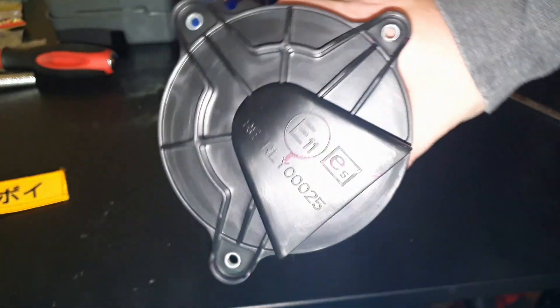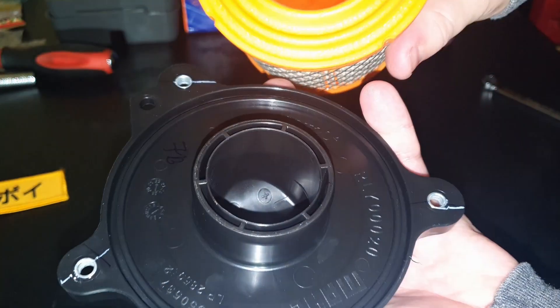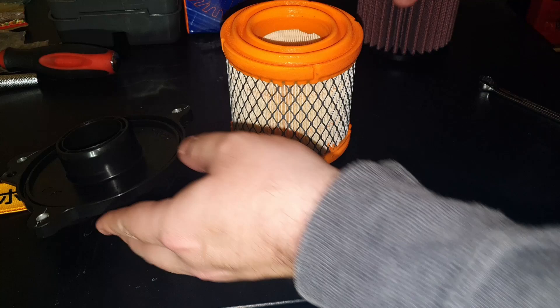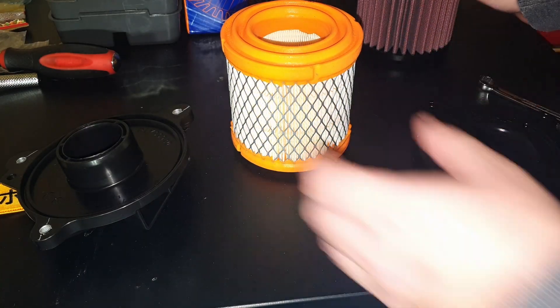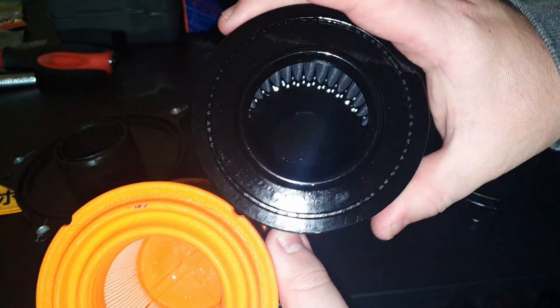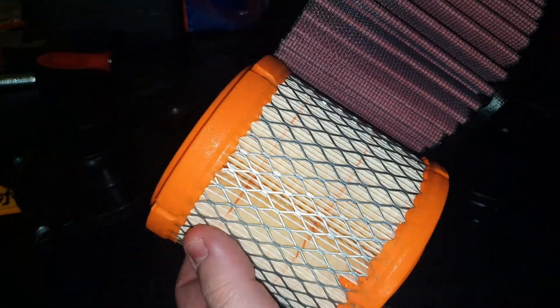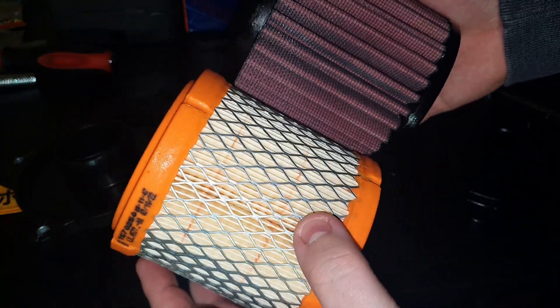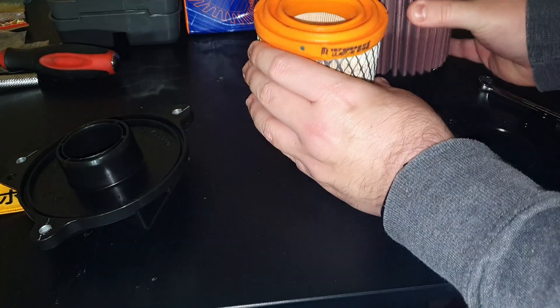The original filter is an air filter that comes with a plate that has a 90-degree turn on the air going down — that's to discourage water ingress — and it's just a foam and paper construction. Nothing wrong with it, it works, but I'm replacing it with this DNA air filter, which is an oiled air filter. It has fewer pleats so less surface area, but the oiled air filter is going to do a better job, so we can afford lower surface area but have better flow.